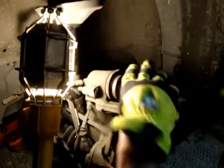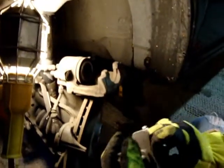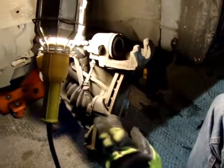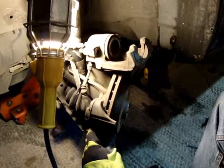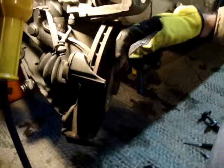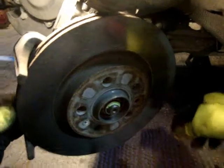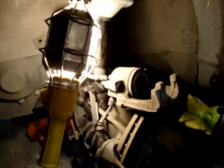Now I'm going to loosen this up and pull this guy out of here. I'll clean up the calipers and any mating surface that these new pads are going to have, even out here. Check the rotors — make sure that they're nice and smooth, which these ones are. If they have any weird grooves or don't feel even, you either want to replace them or have them machined down smooth.